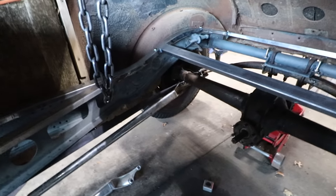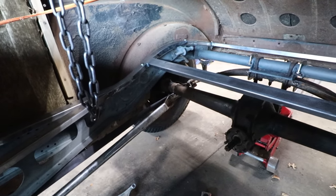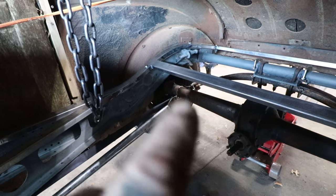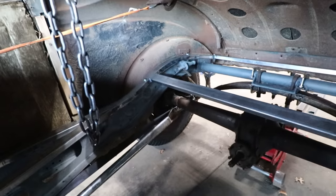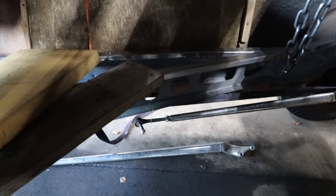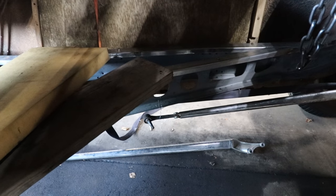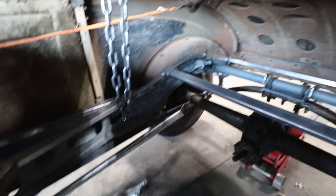So what I'm going to need to do is make some tabs, much like people do with the 35-36 radius rods, and mount them right in here where I have it just wired up. Make some tabs and mount in there, and then up in here, you can see the tie rod is up in there somewhere. I'm going to have to make a mount that's going to come off of this X member section. So that's kind of, we had to set the body down just to get an idea where everything was